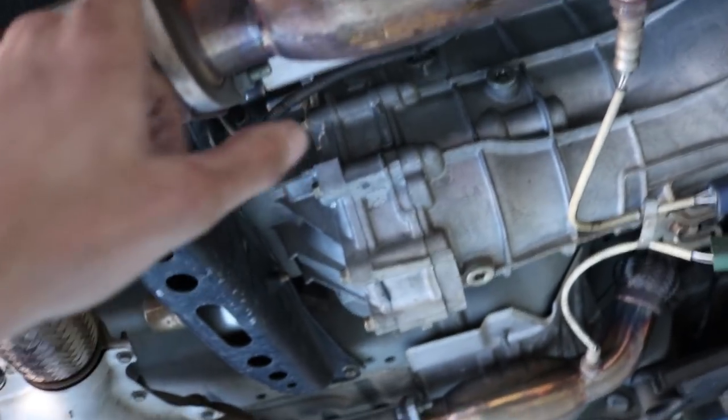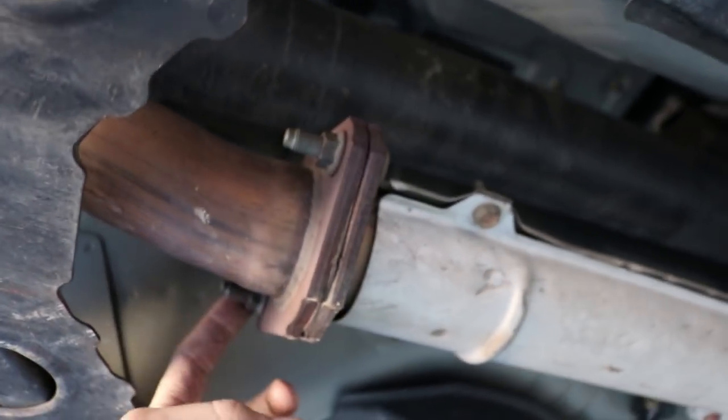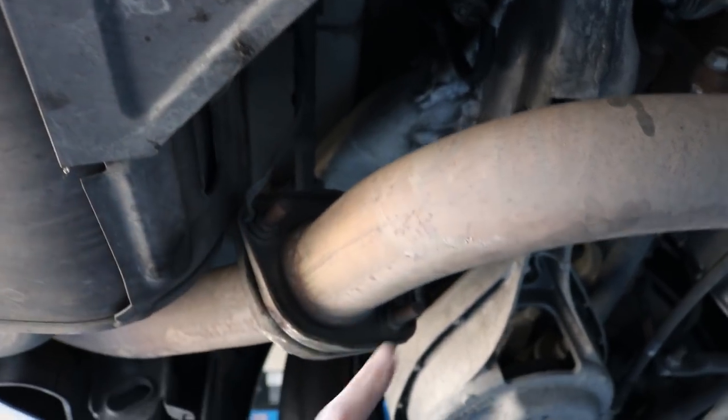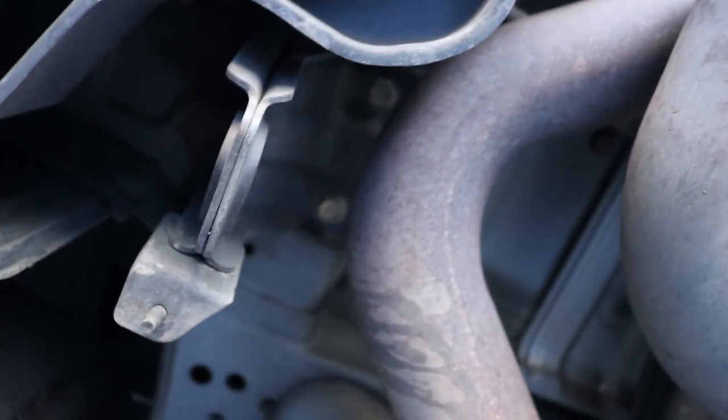I'm going to do a quick rundown on how to drop your exhaust. You've got your two 14-millimeter bolts here on the stock system, with a nut on the back on both sides - so four up front, all 14s. You've got two right here tapped into the Y-pipe, and on the reverse side there is a 14-millimeter nut. Up here you've got two 14s and another 14 that's usually on the other side of the grounding strap. So there are two 14s and then another 14 on top of that, which drops the mid pipe.